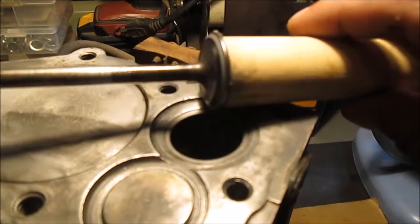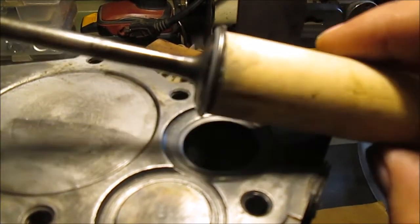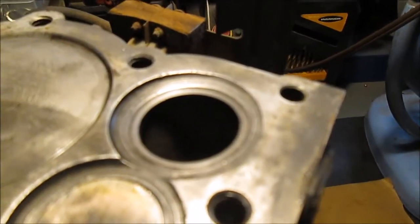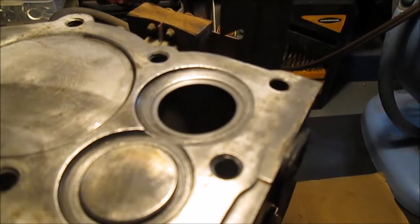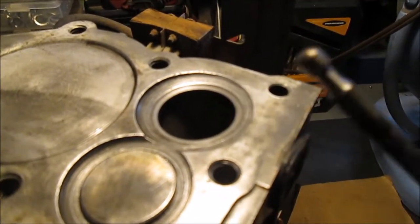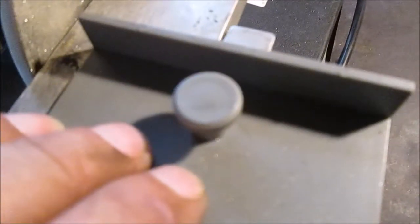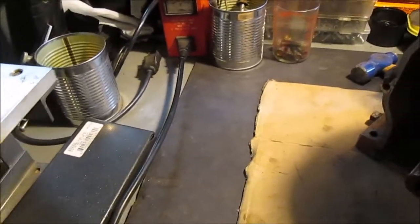There's the intake valve. All I did was pop this off and took a little bit of alcohol to clean the glue off. That will be the end of this part — I think it's part three. Next time we'll show you adjusting the valve lash clearance by grinding the tip off. We'll be using the little diamond thing. We also have a thing here to keep it at 90 degrees that we clamp on. See you next time. Thanks for watching.